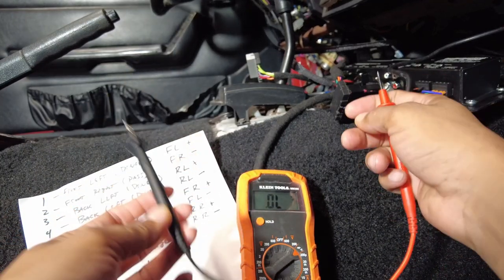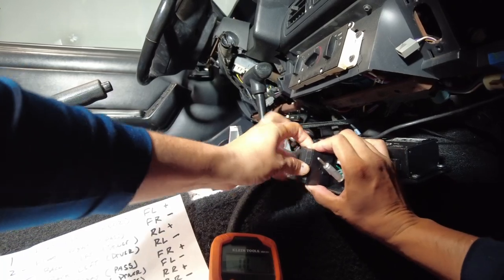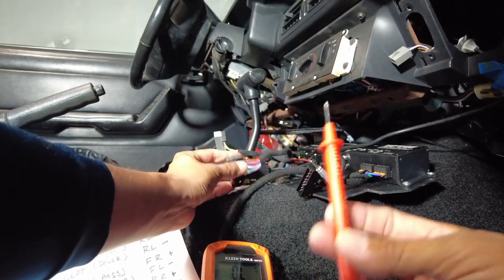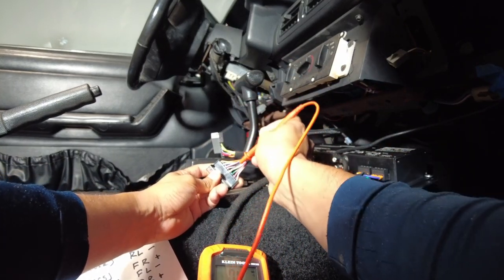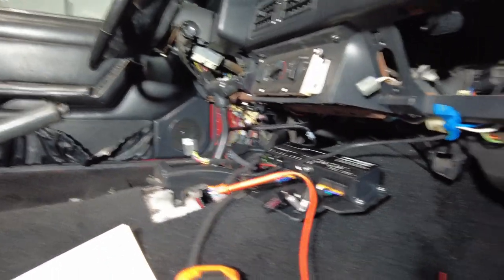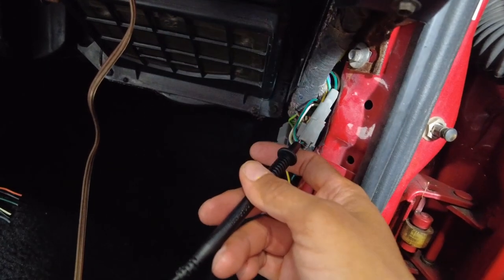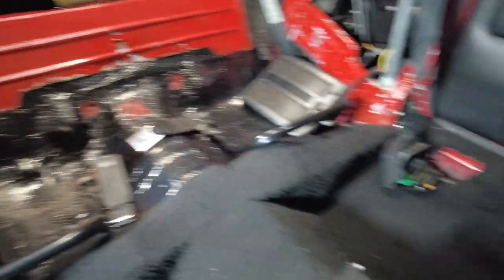So how do we test? Let's go up here to the factory harness. Mine has already been fixed, so I don't have this problem — but you guys may. We're going to go ahead and insert either probe — you can put red here, you can put black here, it doesn't matter. We're going to randomly pick one wire. So we have to figure out where that speaker is, and what you want to do is work your way around the vehicle and test the speaker connections until you find out which one beeps. Now we're going to go all the way to the back of the car.